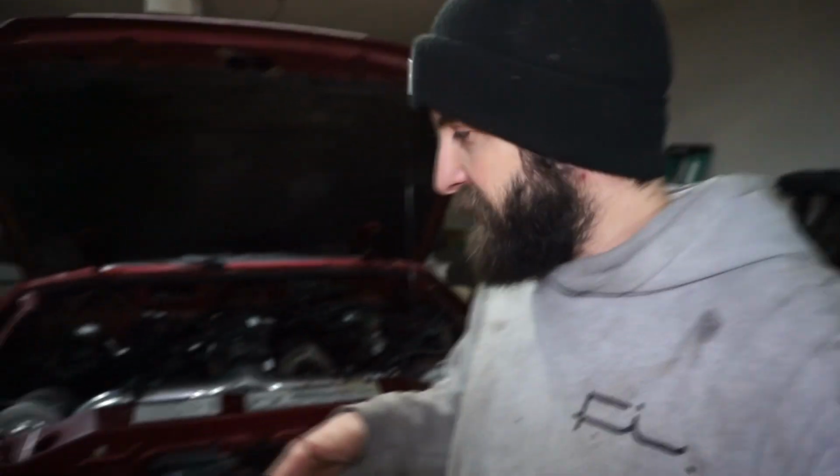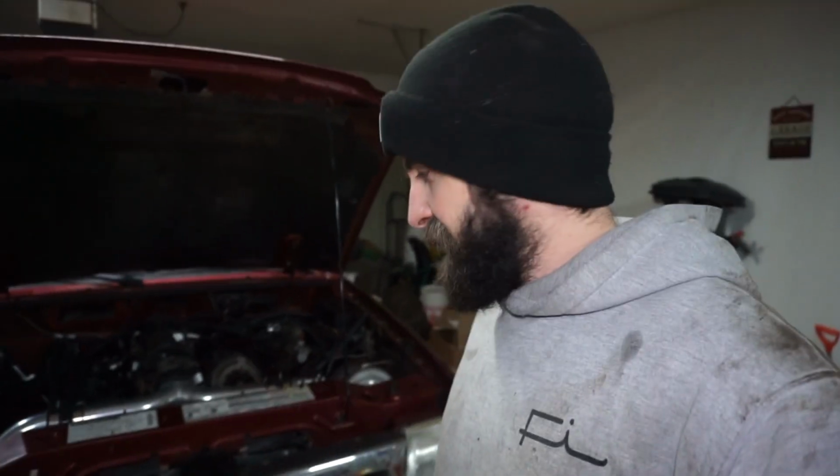Like there's an oil leak where I have the drain going into the pan. So I'd probably like to drop the pan and then weld the bung on. This thing leaks everywhere, so I've got leak issues. So hopefully we'll fix some of that stuff. This transmission doesn't have the nice rubber gasket on it. It just has one of the crappy cork material gaskets, so it's not that good, and that one's leaking.